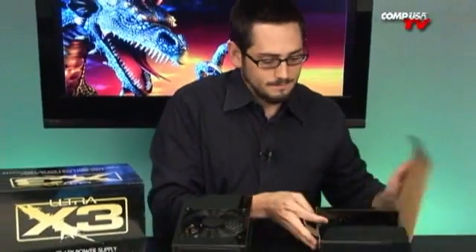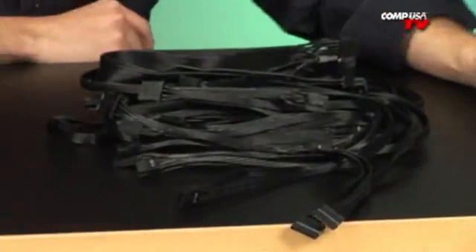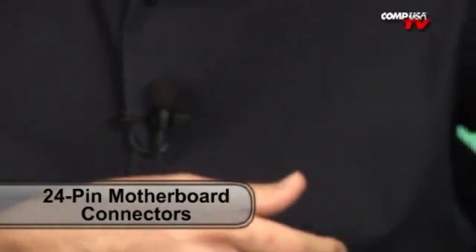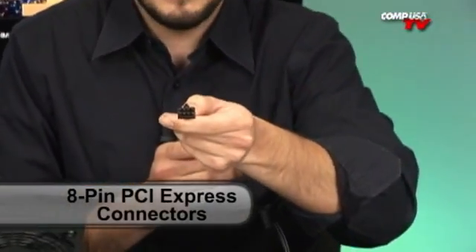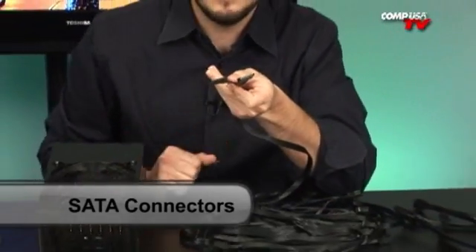Let's talk about the connectivity. Check this out — this is insane. I'm just going to dump them out because there are just way too many. Unbelievable amount of connectivity. You've got a 24-pin motherboard connector, modular in the box. PCI Express connectors — here's an 8-pin, you have two of those. SATA connectors — you get 10 of those. You get 10 Molex connectors. So that's 20 connectors for hard drives and peripherals alone. You have an 8-pin motherboard connector for the 12 volt, a 4-pin motherboard, four 6-pin PCI Express, and two 8-pin PCI Express. So pretty much: 10 hard drives, 10 optical drives, a motherboard, a water cooling system, fans, and 2 or 3 very big video cards.